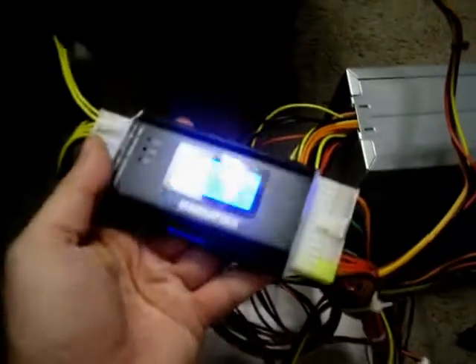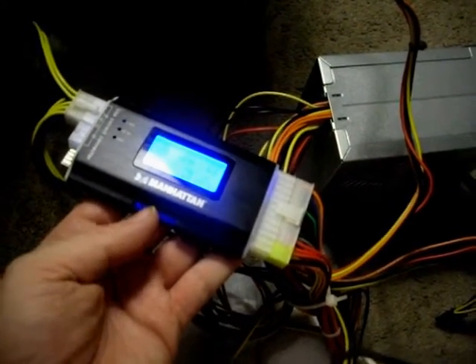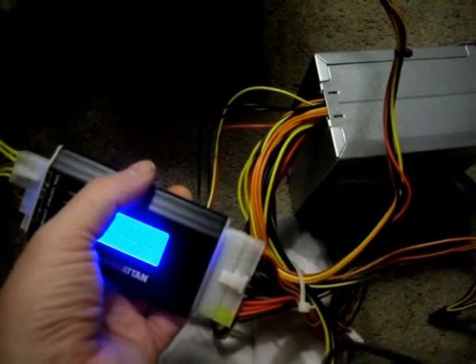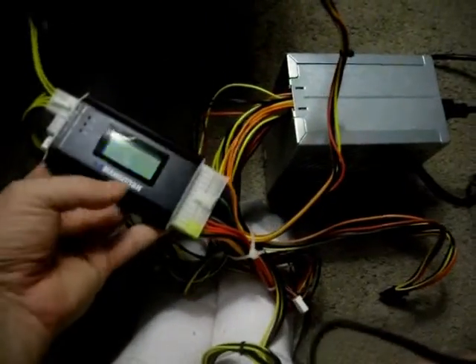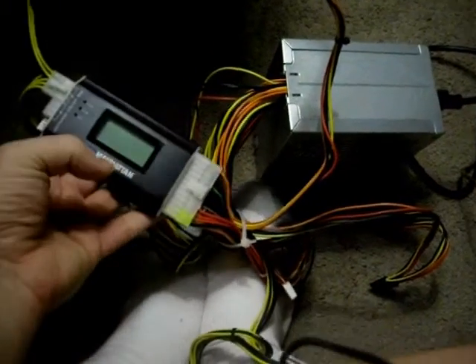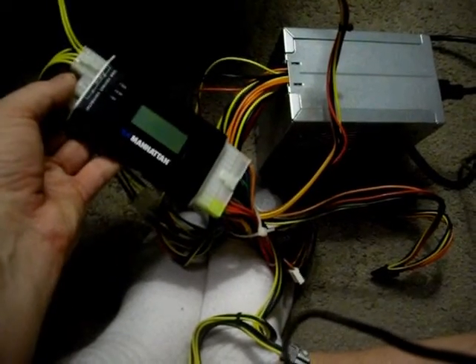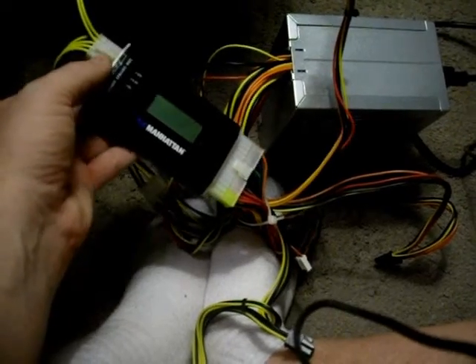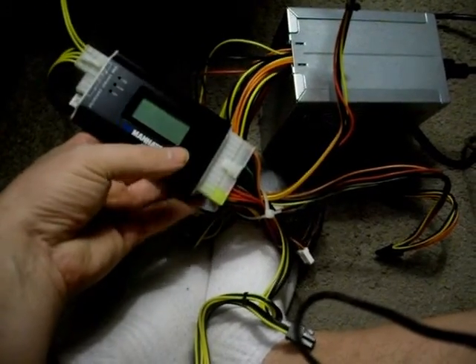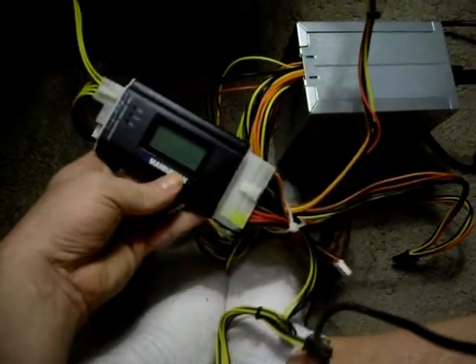What you'll want to do if you have this or if you buy this is you'll only want to check one connector at a time. Put in a connector here and one up here, but only check one of them at a time. So you'll want to power it off first, then go ahead and connect one — either here or here — and check it. Or you can pull that out and plug in your four-pin over here and check that. Or pull this out and plug in your six-pin and check that. You never want to plug everything in at once or it won't give you accurate readings.